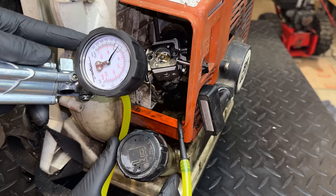So I take back what I said earlier about this flooding over when the engine is shut off due to the tank being overpressurized. The needle seems like it's more than capable of holding that 3 psi back. So what I'm thinking now is that the issue that was reported was that it runs fine, he shuts it down, and he can't restart it. And when I just started it, it seemed like it was running really rich. So I'm thinking those needles are out of adjustment. And it's good enough to run it, but when you shut it down, there's just so much fuel in there that the spark plug most likely can't spark. It just gets too wet.